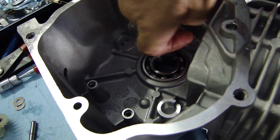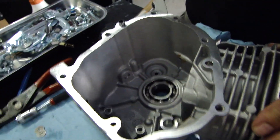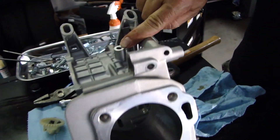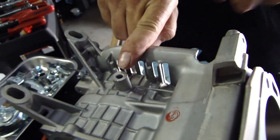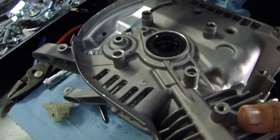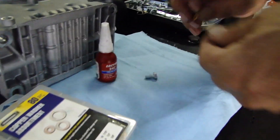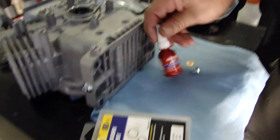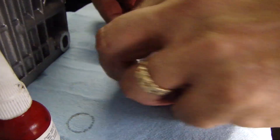Now it's basically bare. What do you do with the holes? A lot of guys put nuts and bolts in them. I like to use a quarter-20 by half-inch bolt with a copper washer and some Loctite, and I run them in with the zip gun — it will self-thread into the block, seals it, and it'll never come back out. This other hole I'm going to tap and put a fitting on it for a breather, and feed that up to the valve cover so it'll splash-lubricate the top of the valve train. Here's how I close up the governor hole: quarter-20 by half-inch length bolt, seven-sixteenths head, copper sealing washer — buy a pack of these at Harbor Freight, I use them for everything, oil pan drain plug stuff like that — and some Loctite. Give it a little drop. That thread will self-cut into this aluminum casing.